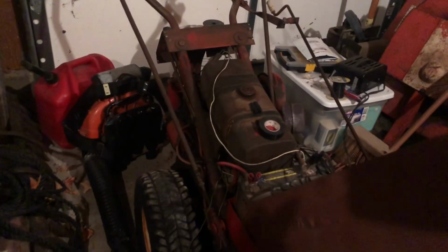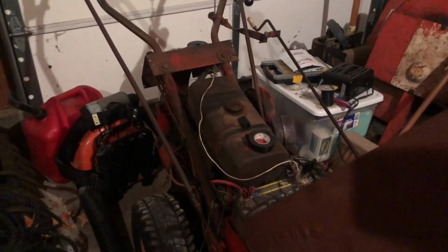Well, I started to work on this C10A here probably over 6 months ago, and I bought the parts to fix it probably like, I don't know, 2 years ago. And now it's about 2 hours before the snowstorm is coming, and I'm deciding to fix it. And the issue was that the voltage regulator was shot. So I decided to wire in a new one. And part of that, there was never the proper connector off the stator. They just had 2 butt connectors on there. So I just wired up the proper Delphi connector that I had bought. It's just like the OEM connector on there.